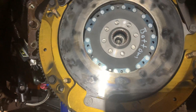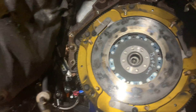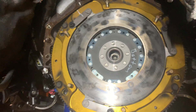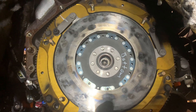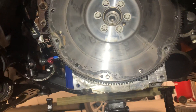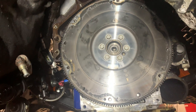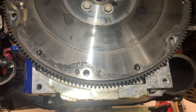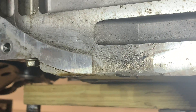I had to lower the engine with an engine cradle a few more inches to get to the bell housing bolts. Taking the clutch out, you can see there's some scoring — I don't know if it's supposed to look like that, but 700 pound-feet of torque probably isn't going to do it. There's the flywheel — obviously where the clutch pack goes — and that surface is also scored. I'm going to replace the rear main seal because I have a little oil leak and I think it's coming from that. We're going to upgrade to the RXT. While I'm here I want to address everything because I don't want to do this again for a long time.